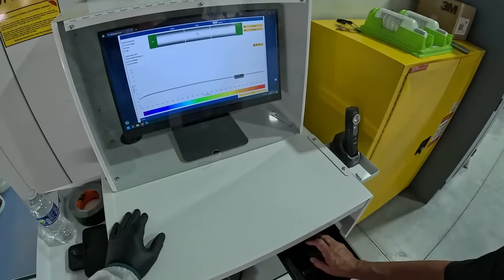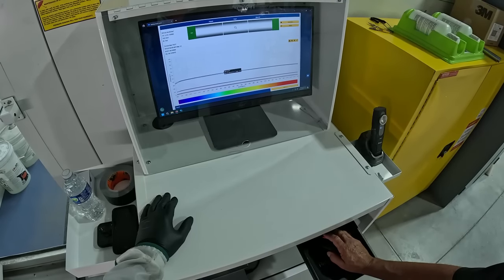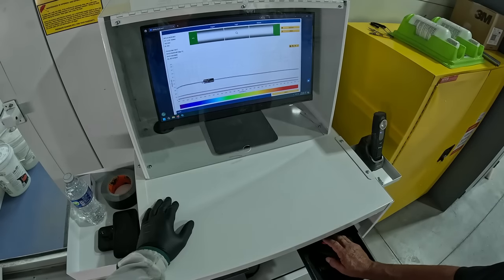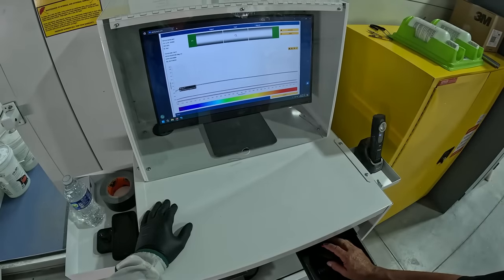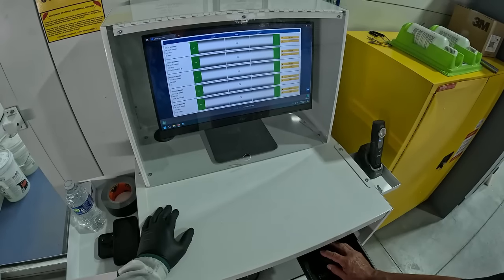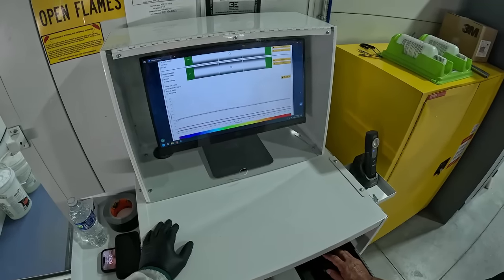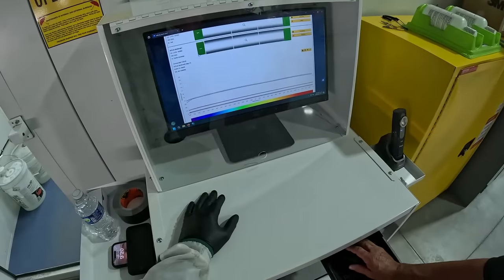You can see, we're going to blow it up a little bit. This is going to be your 25 degree angle. It's more head on face. And then your flop will be down here on these lines. That green line is above our target. It's going to be a little lighter on the face, but you will never even see that. And our match is pretty well following that blue target line pretty close. We can hit details again and look at a different variant. This is a darker, dirtier variant. Hit details, and we can look at this spectral curve. That looks pretty good too. So the green is us? The green is the adjusted. Red is a real color. That's your left side, real color.